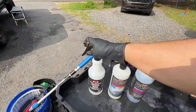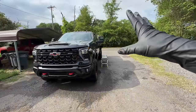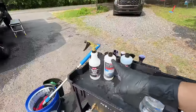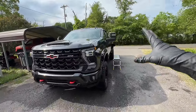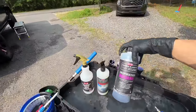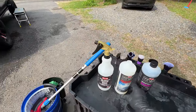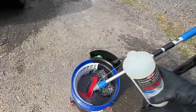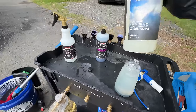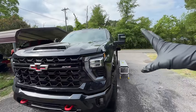We're going to foam on straight over the Crystal Wash with Frostbite — it's got a pH of 9.5 at a 10-to-1 dilution — so that will act as our foaming pre-soak, hopefully knocking off all the bug junk in the front and the pollen sitting on it. Frostbite in combination with Crystal Wash should do a full decontamination prep stage, and then we come in with the bucket wash. Just a couple ounces in our bucket at a 10-to-1 dilution for maximum cleaning power.